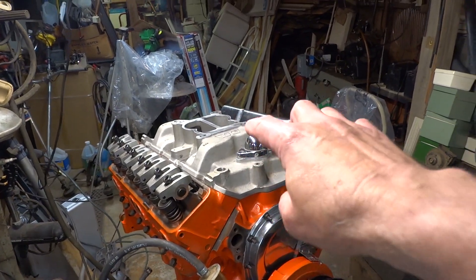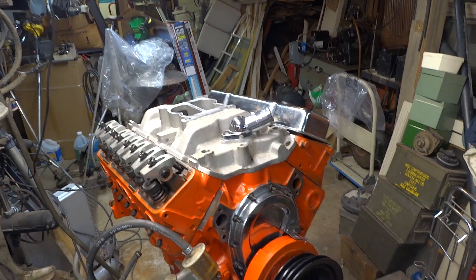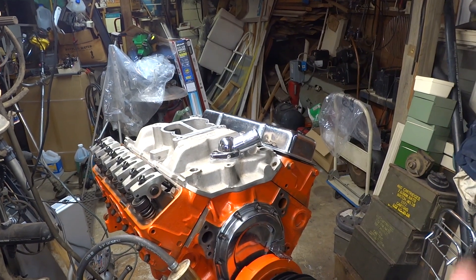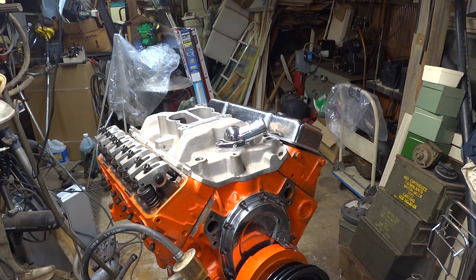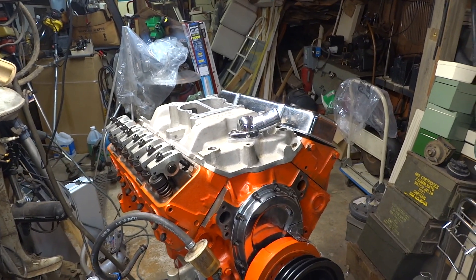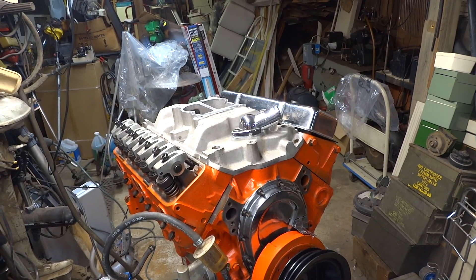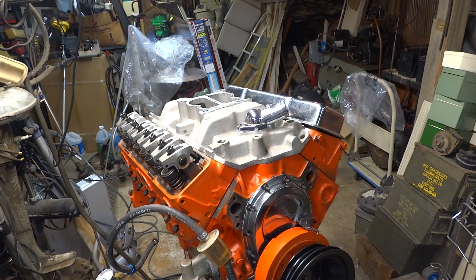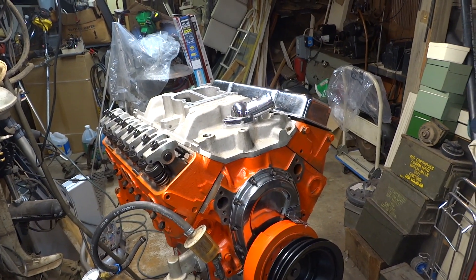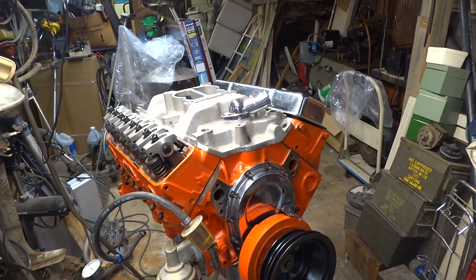I had to make a modification to the intake, dropping it down about a half an inch where it cross-flows a little better. The only other thing I've got to figure out is if I want to run the Edelbrock or the Quadrajet. I like Quadrajets — they will flow 750 CFM. That Edelbrock I've got over there is only a 600 or maybe a 650. I've got another one that could go on here that is a 750, but I just like the way a Quadrajet works. The problem is the new ethanol gas doesn't like Quadrajets, so that creates one of those situations.